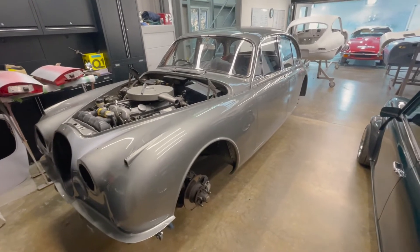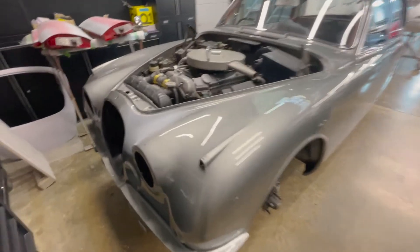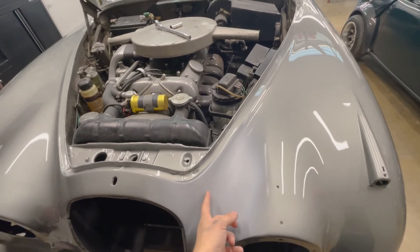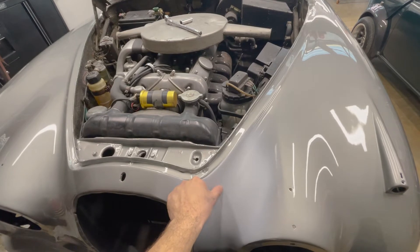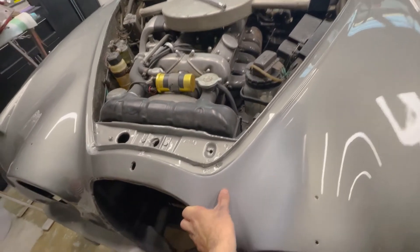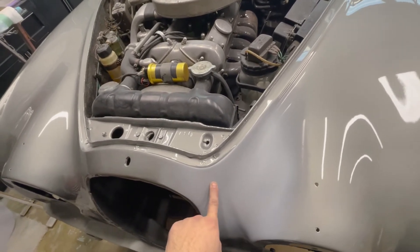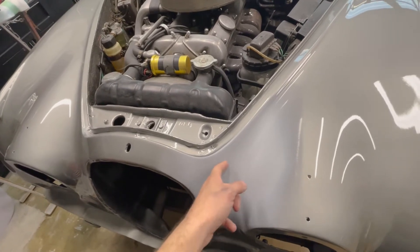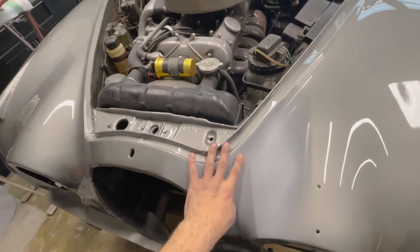We painted it opalescent grey, which is a beautiful colour - if you've ever seen it in the evening at sunset it looks really nice, it's kind of got a yellow shade to it. Unfortunately when we painted it the first time there were some split marks down here that kept coming through. We had to go back right the way through all the paintwork to look at what was going on. It seems that where the body filing was done originally when the car was made, the body file scratches had actually split the metal, so we welded that up and repaired it.